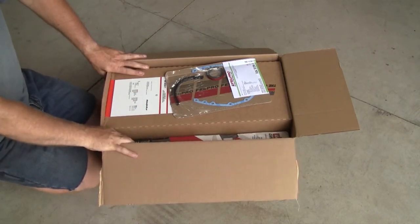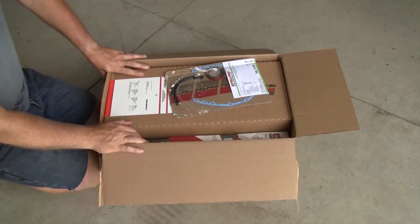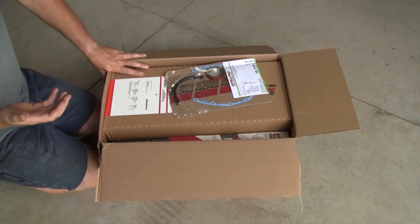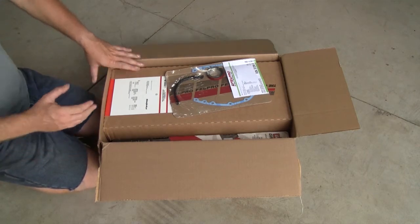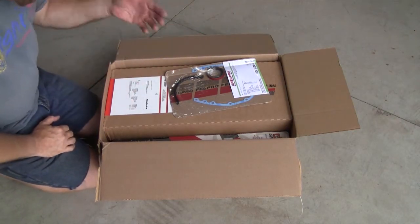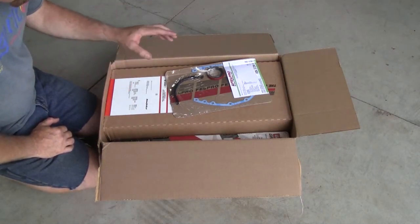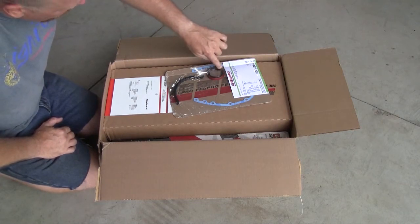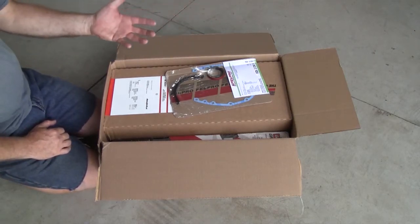The transmission went out on my shop truck, my '55 Chevy pickup truck, and I ordered a bunch of parts. Since I'm pulling the engine out anyway, the timing was acting a little weird so I ordered a timing set — and that's a really good thing because it was about ready to come apart, it was really sloppy. I also had an oil leak on the front — some of that is the valley pan gasket, and some is from the front of the timing gear cover.